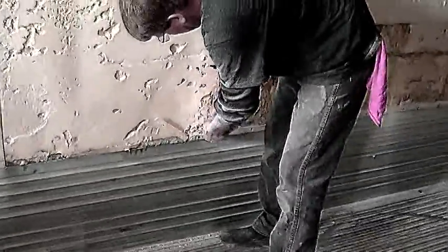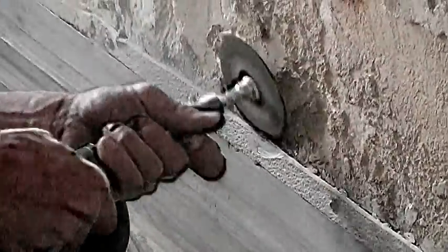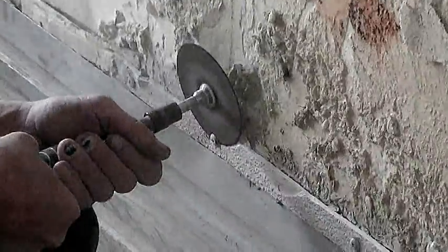Section removed. Now we will work on the bottom strip and rivets. We will fill in holes with foam later. Normally the bottom strip just pulls out, but with the rivets we will have to saw them off. You can use the cut-off saw or the oscillating tool for this. After you have sawed the rivets off, the pry bar is handy for getting this section off.